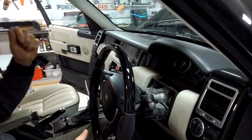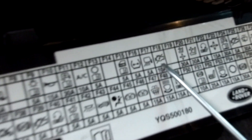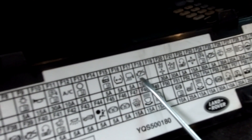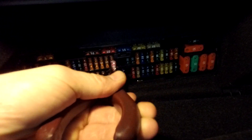Now if you get stuck somewhere, what you can do is remove — so fuse 18. What's the picture on fuse 18? Interestingly it looks like an engine, so I think it's to do with the ignition. Let's take the keys out and whip out fuse 18. Fuse 18 is the 10 amp fuse right in the middle — you should have a 10 amp fuse with a gap next to it. Take that out, give it a couple of minutes, and that should reset it. Then put it back in.